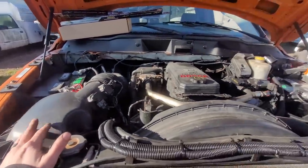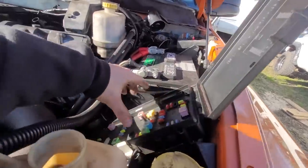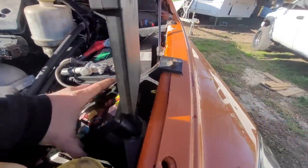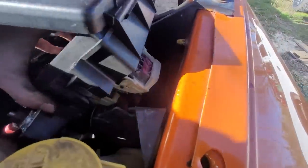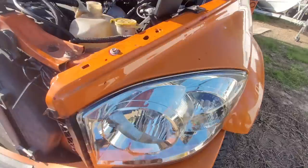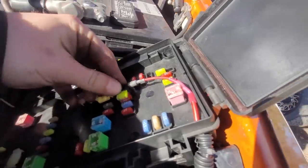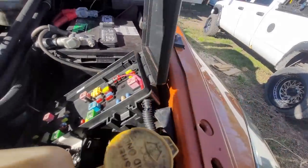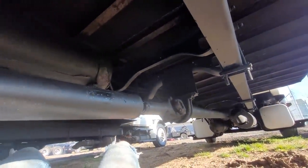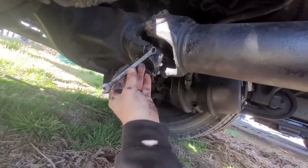He's been fighting that issue since he bought the truck. We're going to get that nice and routed up. You guys can see this whole fuse box is kajiggered — it's supposed to sit in there but it does not sit in there right, and you can see all the electrical issues. Half the wires are butt-connected. I'll see if he wants to get those taken care of. We've got the nice little wire right here going in through the side — I put a 20-amp fuse in it, which I think is perfectly fine. Driveshaft installed, grease all done on there as well.